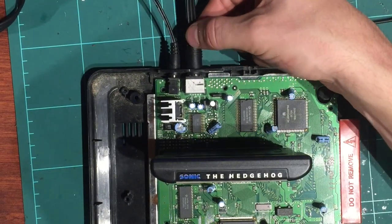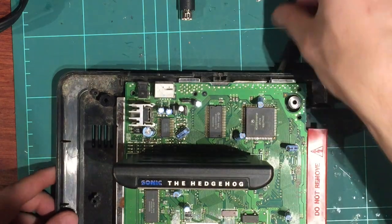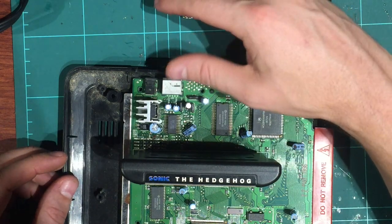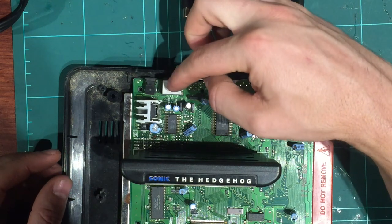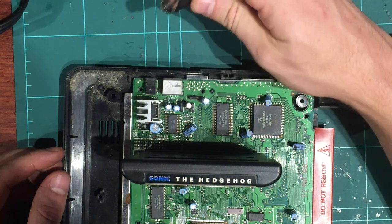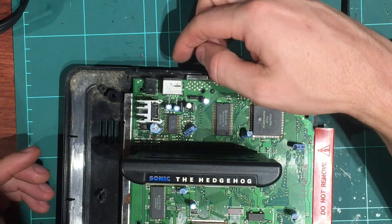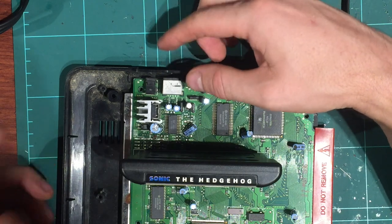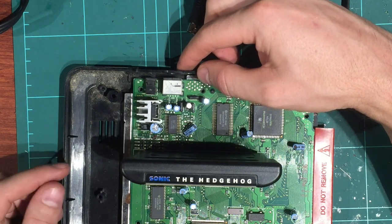I'm still a little suspicious of this multi-out connector - it's 99% perfect, but I'm not sure if it's just dirty or if it's actually damaged inside, stretched, or maybe someone forced the wrong size connector in or jammed something inside it. This is just a composite connector, so what I'll do is grab an RGB SCART cable instead - that uses different pins of the connector. We'll be testing the red, green, blue, sync, ground, power, and stereo audio, pretty much testing all the pins with one connector.